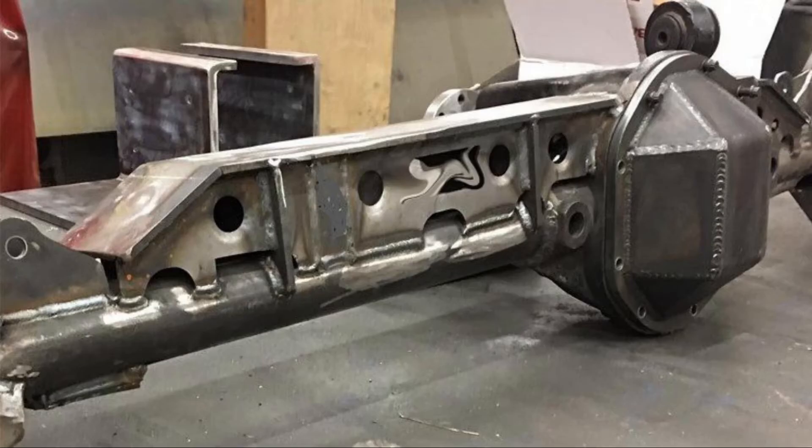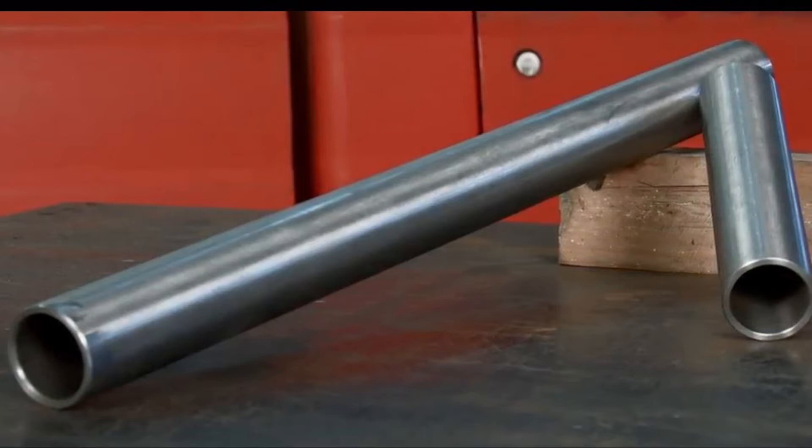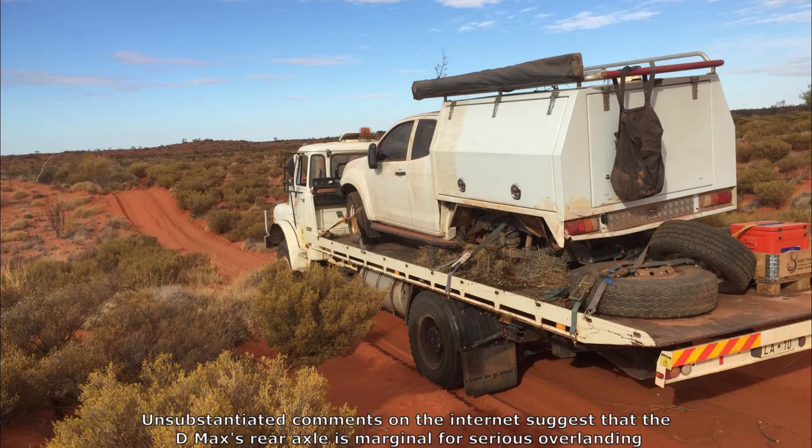Which of these is the efficient way to strengthen the axle of an overland expedition vehicle? If we accept that there are 4x4s out there with axles which are a little bit marginal for serious overlanding, we're going to have to do some axle strengthening sooner or later. I'm talking about vehicles which are heavily loaded up to the GVM, maybe beyond, doing extended mileages over dirt tracks, corrugations — doing enormous fatigue damage to the suspension. Our principal interest is to reduce the fatigue stresses in order to prolong life, not mainly to increase axle strength, although that will be a side benefit.